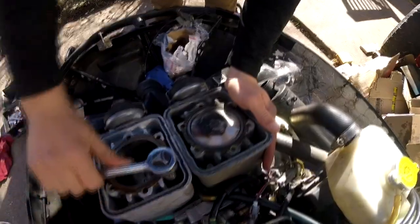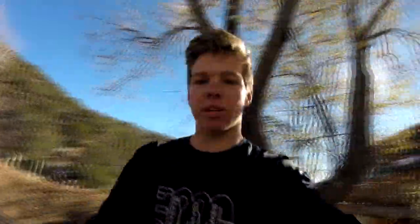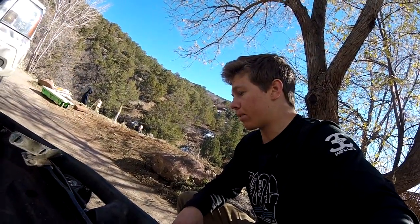Got the cylinders in — found them and the pistons — now we're just tightening the bolts down. It's looking pretty good. It's super scary tightening these bolts down because I've broken like four of them, but good thing I have this huge bag of bolts from eBay for about 30 bucks. I don't want them to crack in the cylinders again because I don't have another one. We got the cylinders on — now we just have to grab the seals and the rings.